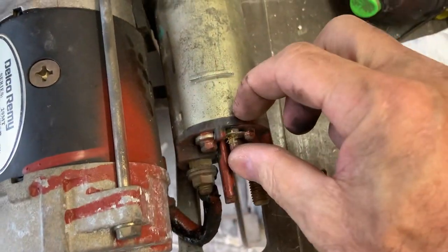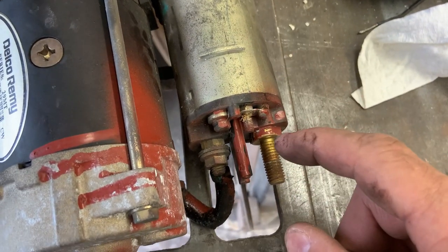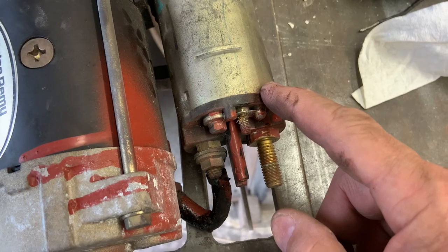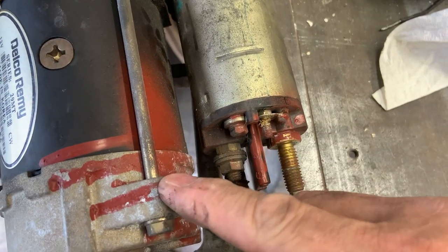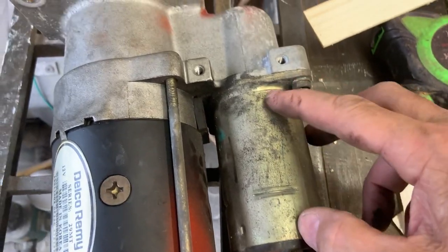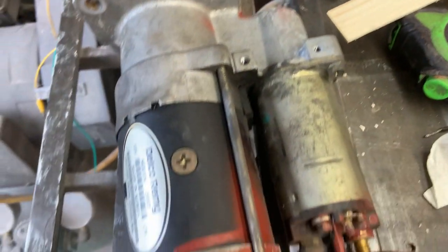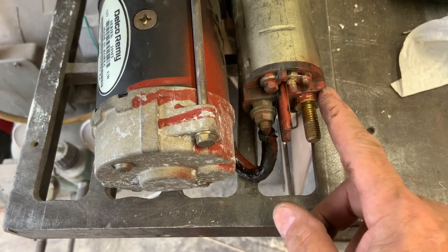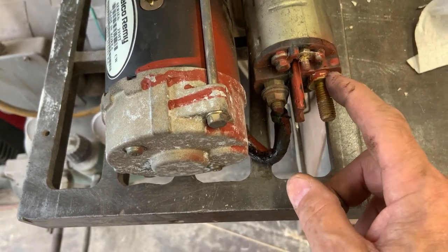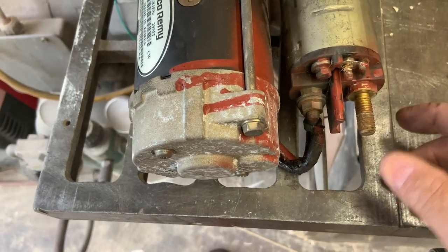It's just a simple electric motor and the solenoid is kind of like a remote control switch — a relay. I think I'll try and see if I can show you how this works with a pair of jumper cables. I can put a ground on here and put positive on here and you'll see this thing energize and push the gear out. I may actually hook power to this as well and the motor will spin up so it'll do everything all at once.